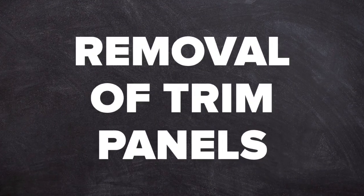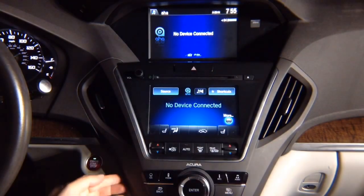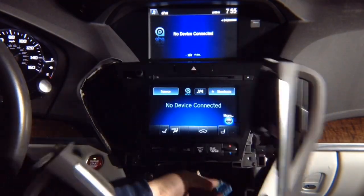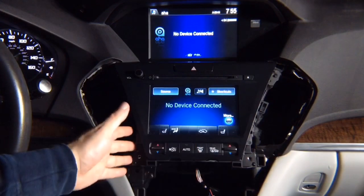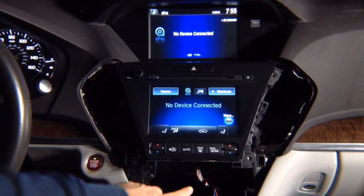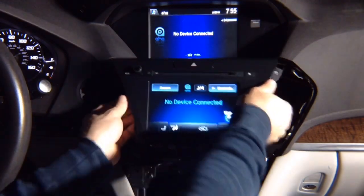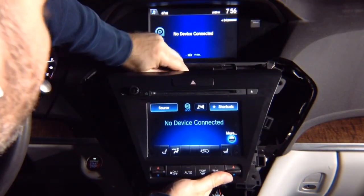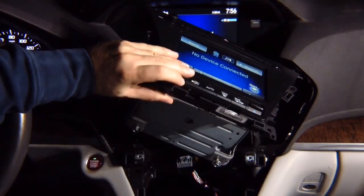Removal of trim panels — this is MDX disassembly; it's similar to other vehicles and we have instructions for others, but it's pretty much all the same. This panel just comes out using a trim tool — pop from one of the corners, and the panel just comes out. In the back, unplug one connector, the blue one, and remove it. Next, remove four screws. Behind the panel at the bottom of the radio, you've got two screws that need to be loosened in order to remove the radio. Remove the four screws first, then loosen the two screws on the bottom — only then will you be able to pull the radio out.